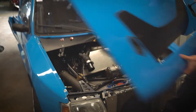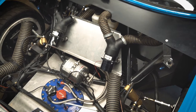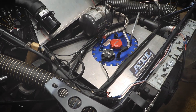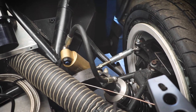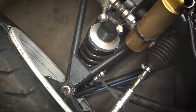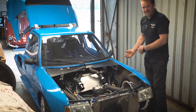Under here, again, we cut the chassis and all the suspension off at the bulkhead. The petrol tank was originally somewhere up here — obviously not good for center of gravity — so we repositioned it as low as we could get it, tucked in amongst the chassis, but it's still easy to access; just remove a couple of bars and you can remove it. We redesigned the chassis to accommodate the double wishbone suspension, so it's a similar setup to the back with full adjustment on caster, camber, and toe. It's also got an anti-roll bar on the front. I haven't bothered with one on the back because the spring stiffnesses are so high, though we may add one later when we're testing.